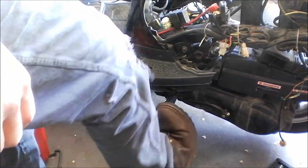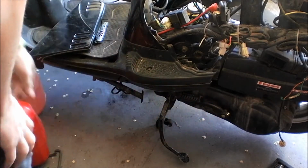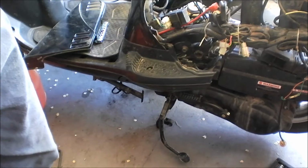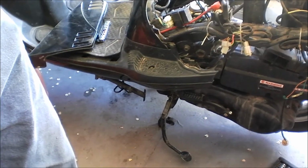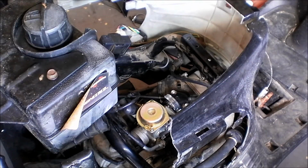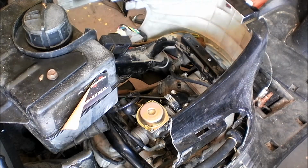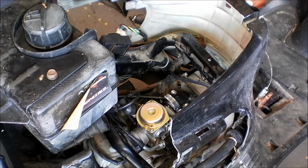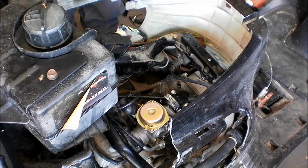So obviously not. That's not helping at all. So let's go further into the carburetor. Do a little more testing before we really start pulling it apart. Alrighty, chibbers. Next test is just see if it will allow to be bottle fed. What I mean by that is I'm gonna spray carburetor cleaner in the intake while I'm trying to start it and see if I can get it to start and run and stay running off carb cleaner.